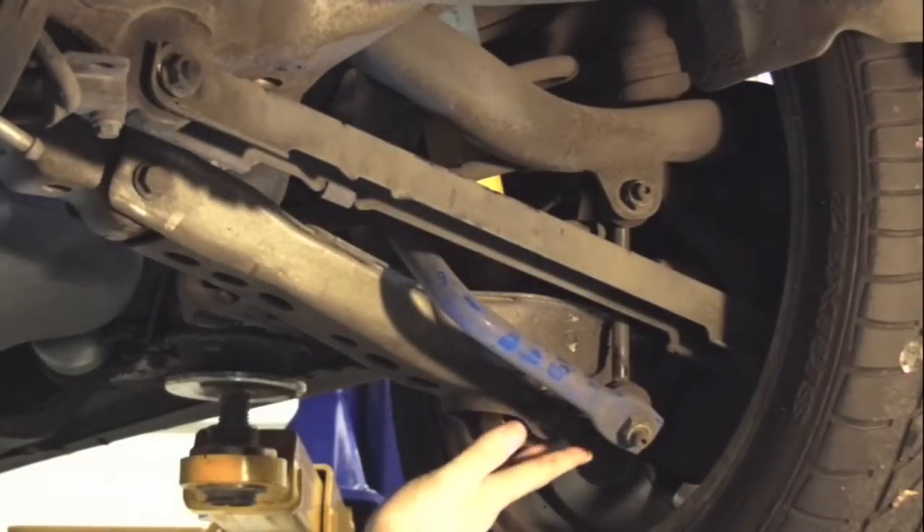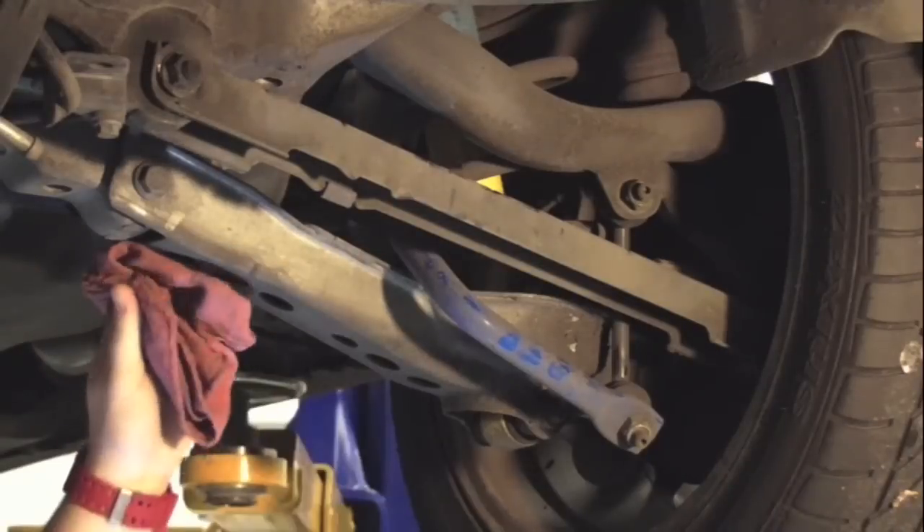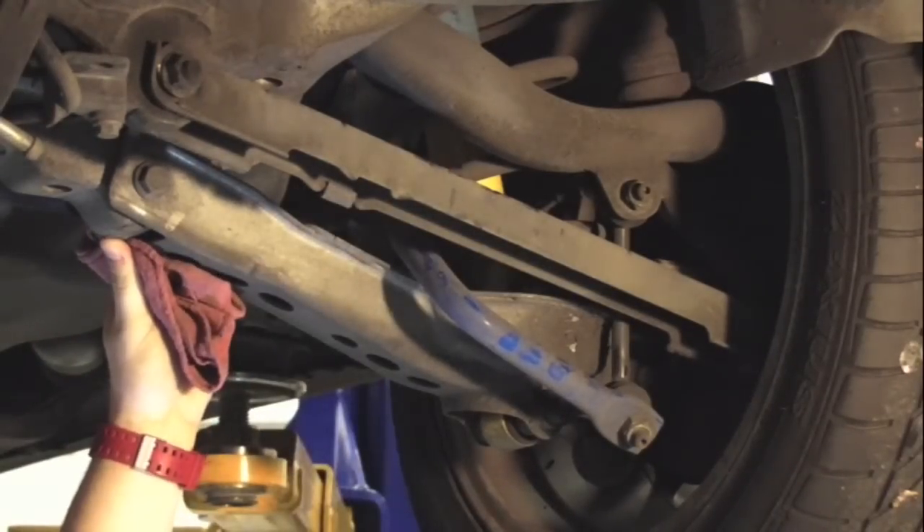The rear shock — as you can see, this car's got a Bilstein Heavy Duty on it. We've got an assortment of different rear shocks that can go on the car if you feel the suspension's getting a little squishy, or if the rear spring's not holding up to your liking, or if you've got some rear end sag. With a non-nivomat shock, you can actually replace the rear springs. Now, talking about nivomats — if you're looking to replace the spring or the rear shocks in your vehicle, you will have to inspect any P2 because those cars did come equipped with a rear nivomat. That's a self-leveling shock that Volvo used which maintained the ride height of the car. It did come with a helper spring, but the nivomat is what maintained the ride height, unlike older Volvos that used a spring to maintain the rear ride height.